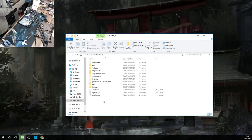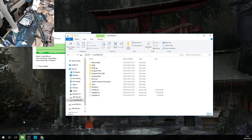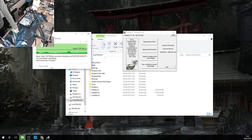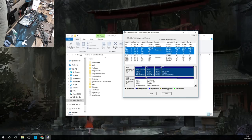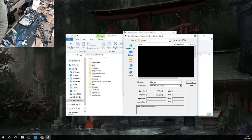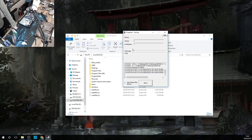The first thing I'm going to do is grab a backup of this drive while I have the opportunity, because the drive might be intermittent and if I lose access I'll be kicking myself. I'm going to run Snapshot, which is the backup utility I use, and grab all the partitions on that Samsung SSD — save, start copy, and make sure it gets going properly and gets up to a sensible speed.